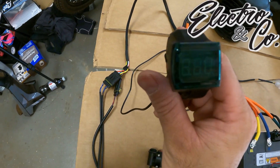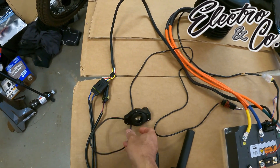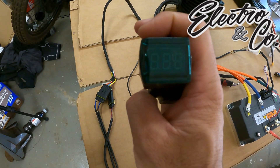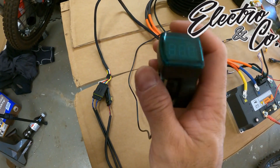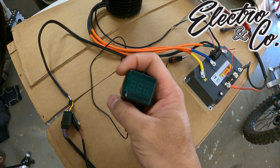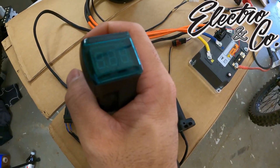What I've learned over the years of doing electric bike stuff is that when you have a bike with a percentage meter, the percentage meter is good but the voltage the battery is running at is a lot more accurate to where you are as a whole pack. A lot of guys when they upgrade their batteries will read the voltage as a more accurate way. I thought it was overkill at first but I agree now - it is much, much better.